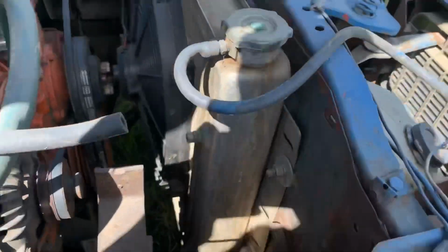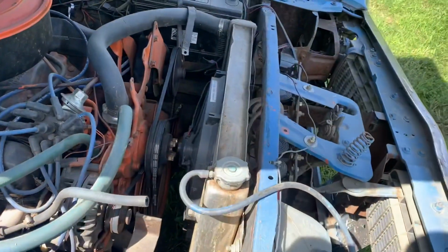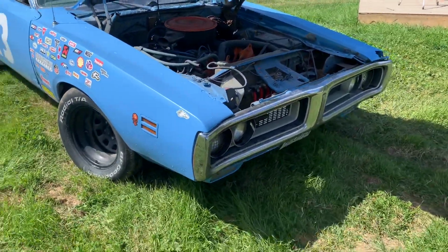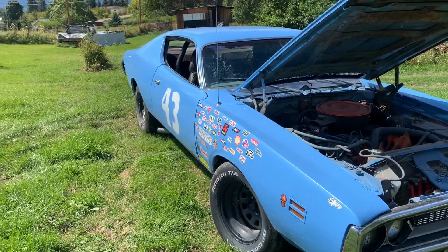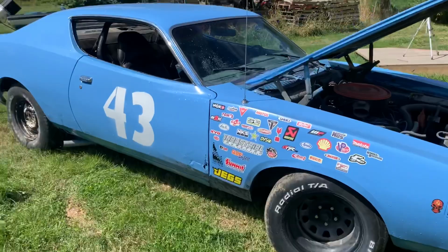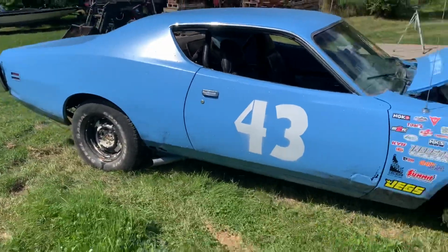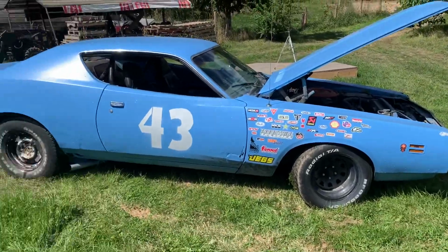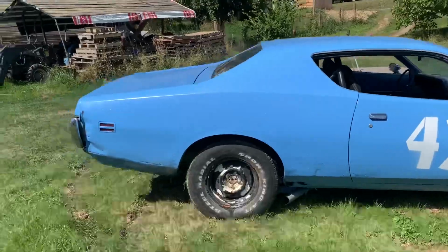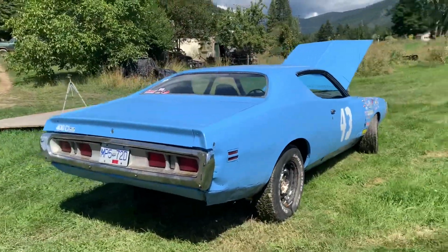Northern all aluminum radiator. Electric fan. Really fun car. Burns a lot of fuel. These cars are kind of becoming more popular. This thing's real rusty. I primed it 4 years ago and just painted it about 4 weeks ago. And I just painted it with rust paint. I mixed it myself. I did 2 liters of paint, did the whole car, 600 mil of thinner.